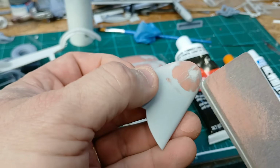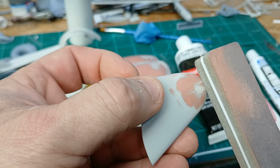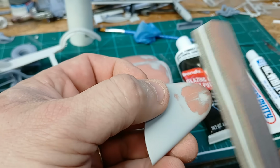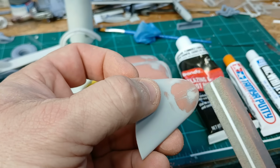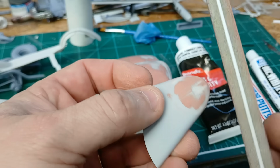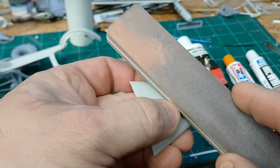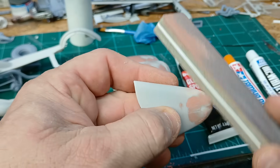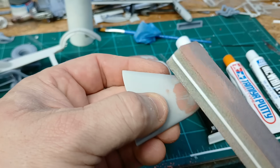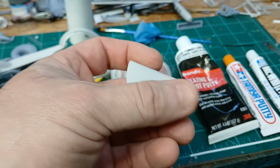Well, that filler is going to be softer than that plastic. And what'll happen is, although you're trying to do a round movement, you're going to dig into that more easily, and so you can cause some damage, and you'll have to redo it. But I didn't already have the styrene in there. I already had the Bondo, so I said, well, heck, I'll just be easy. But anyway, yep, that's it, man.